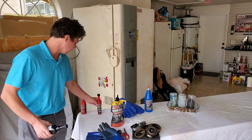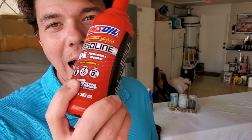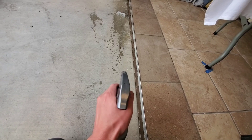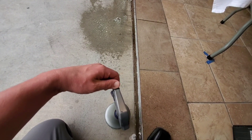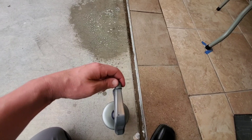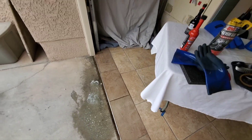Now we've got the PI cleaner. This cleans all the carbon on your injectors. We're going to show you right now exactly how this cleans your injectors. So we got our spray bottle — right now it's shooting completely straight. Now we're going to turn this and get it to atomize. See how it's atomizing now? It's not shooting straight — it's kind of misting. Well, that's what happens when your injectors are running properly: you have this beautiful atomization. But when your injector is dirty, it actually shoots completely straight. You might think more fluid is coming out, but it actually has to do with the amount of air between each droplet of fuel, which allows it to burn. So if you don't burn the fuel, you're just wasting it — basically it's blowing by.